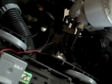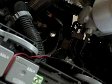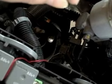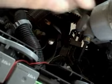So route it around the frame however you best see fit. I recommend using a conduit, this is a conduit type right here. Wrap your wire in that, keep it out of the way of any moving parts, and then run it all the way back and splice it straight into the red wire off of your lights. You're going to have 4 lights, but you'll have 2 red wires, 2 ground wires. The 2 ground wires will be spliced into one end of the switch in the tailgate, the other end of that one going to the frame, and the red wire will be spliced into the two wires that you'll join together, the 2 red wires from your left and right side power wires.